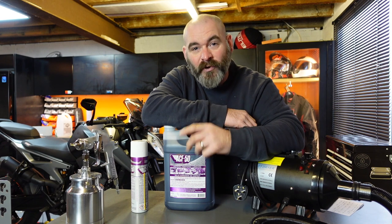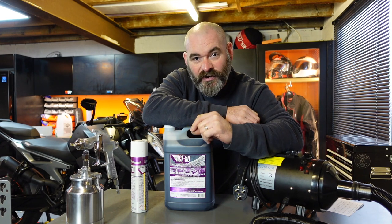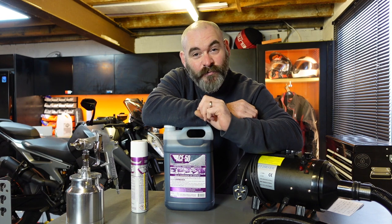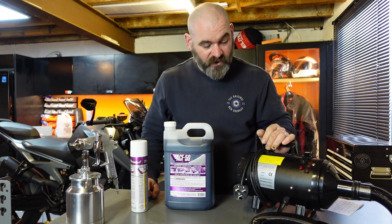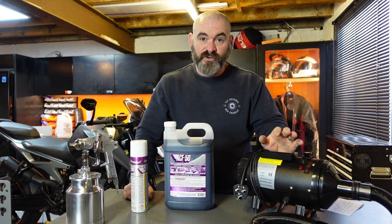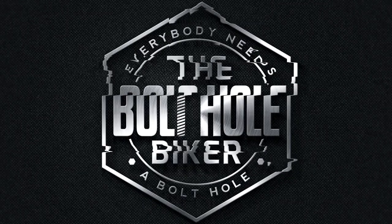And I'm not talking about the bodywork, you know, that's easy. It's the bits inside that you can't get to with a chamois or a towel that you need drying. The bits where the water's just going to sit and eat away at your bike. Well, this eliminates that because you can force the water out. They're really good. I can highly recommend getting a motorbike dryer or a pet dryer equivalent to dry your bike after you've been out in the wet winter weather.